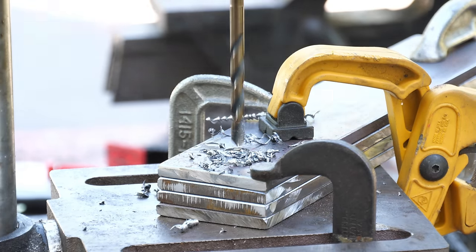With the hardware in position, all we have to do is hold the bolt head still and turn the nuts counterclockwise to force the sides of the shackle apart with a fair bit of force. We'll open those up until they're about 3¼ inches apart, and then turn the nuts clockwise to let them spring back. They do move a fair bit, but we can see that a sleeve now fits nicely.